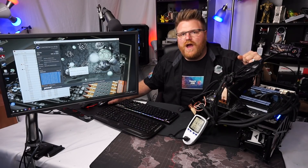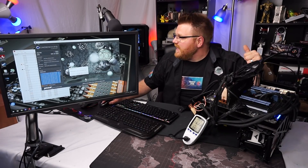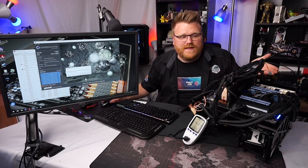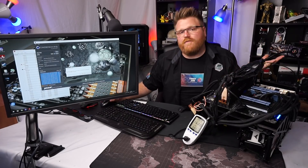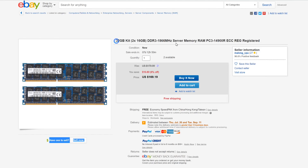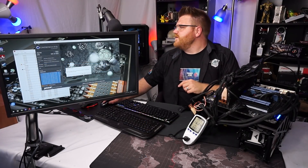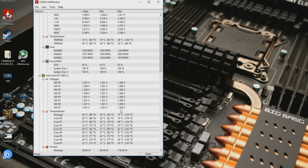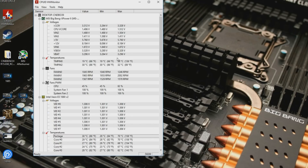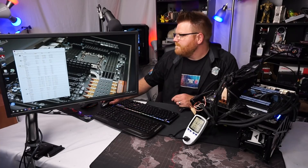Scoring 1651, keeping in mind that Ryzen 1700 overclocked to 3.9 gigahertz probably gets around 1700, and if you're lucky with an 1800X near 4 gigahertz it'll do like 1800. So it's a pretty damn good platform, especially considering you can put ECC memory in this. One of the best things you can do with X79 is grab some cheap server DDR3 memory - it'll work and be much cheaper than used DDR3 with crazy heat sinks off eBay. The package temperature got up to 70 degrees, which is not bad at all.